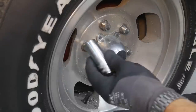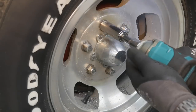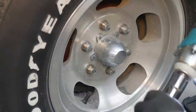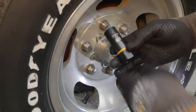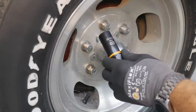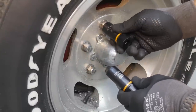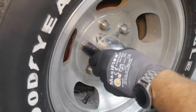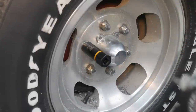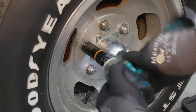Okay, just to confirm, this is the socket that we actually torqued it with, which is a 13 sixteenths. I'm going to put this on my impact wrench, put it in loosen mode, and we'll see. No chance whatsoever — nothing to grab onto. Okay, so we are going to take our GearWrench Bolt Biter and this is the 21 and 13 sixteenths — so it works with 21 millimeter as well as 13 sixteenths. We also have a 21 minus and a 13 sixteenth minus, so if it's even smaller you could hammer that on as well. But it's ready for the regular 13 sixteenths. I'm going to put this on — I'm not going to hammer it on at all, I'm just going to slide it on. Got my Makita impact wrench, mode four loosen, and there we go.